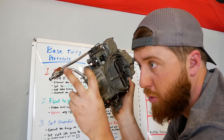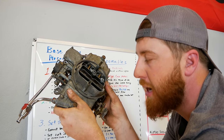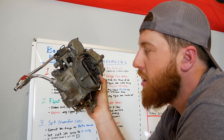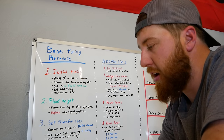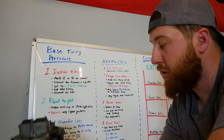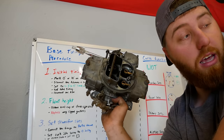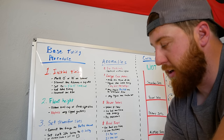Until we literally observe it, we cannot assume what it is. Brand new carburetors — ones you take straight out of the box — you can assume what's in them because they should be exactly what it says on the tech card or on Summit or Holley's website. They list all your jet sizes, all your power valves, everything. Plus you know no one has screwed with them, like running mix screws all the way in and mushrooming them out.